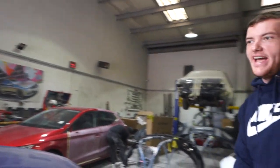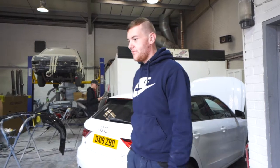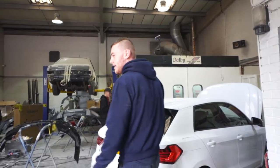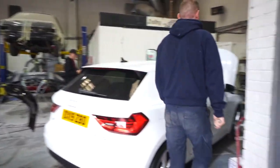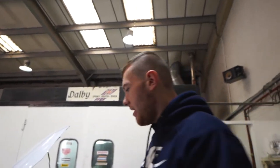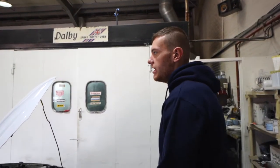So here we've got a Seat - I can't pronounce the name of it, a Rosa or something like that. The first one we've had in, to be honest. As you can see the damage is quite high. We're changing some of the parts on it. We spray the front end all the way up to the mirror caps, just to make sure that all the stone chips are gone. That's what the customer wanted - we need to do it from the dealership's standard. Any stone chips will be removed; it would be like a factory painting. And that's what we're doing to this.